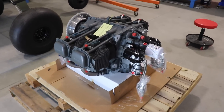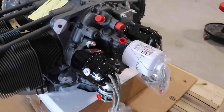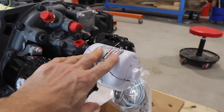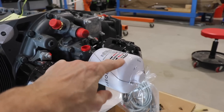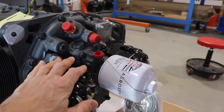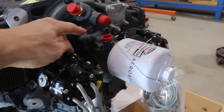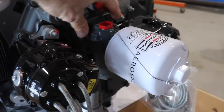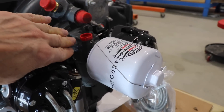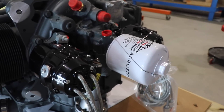There are a few things I need to do before I can put this on the hoist and bolt it to the engine mount. When I was talking to Roger about this engine, he warned me that this oil filter as it sits on the engine won't fit — the engine is too close to the firewall and it will wind up hitting the nose gear in the center of the fuselage. So I have to get a remote oil filter kit from somewhere like Aircraft Spruce. The way that works is I unbolt four bolts on this bracket, the whole thing comes off, and then another bracket goes on with some hoses and the oil filter gets mounted remotely on the firewall.